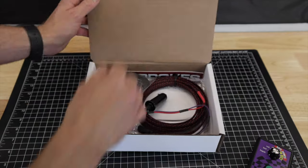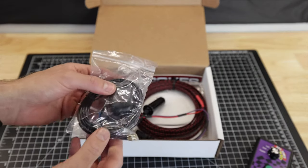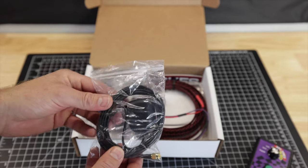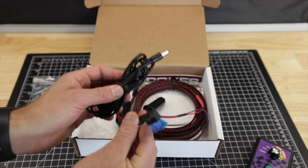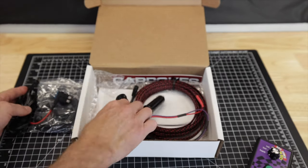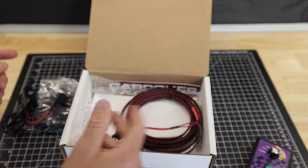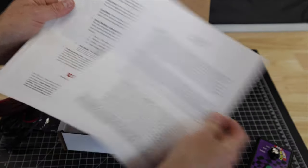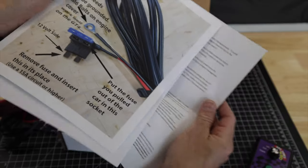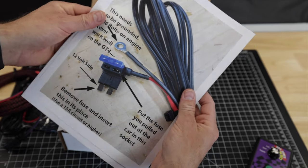Let's open the box and see what's inside. First, we've got an external GPS antenna — it's magnetic. You can use it if you want, but I use my Track Nanny without it. If you use it, it helps guarantee your signal. Here's the fuse tap with power, the suggested method. This is the cigarette lighter adapter that Tom suggests you just throw out. This is the wiring harness — all plug and play. The box also comes with instructions, and I love that Tom includes a diagram of the fuse tap, because even I forget which side is the 12-volt side.